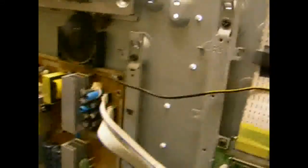If you have a multimeter, it's a very handy piece of kit — you've really got to have one for TV repair. You can then find the 13V rail, which I believe is this one here. It's actually 11.8V, so the TV is still working on it, but it should be 13V or thereabouts. These capacitors are probably 16V rated, so they're filtering the 13V line. There is absolutely no need to upgrade the voltages on these Samsungs. It's a theory that Samsung used voltages that were too low, but if they'd done that, these TVs would have lasted one month — not 13 months, or conveniently one month past the warranty.